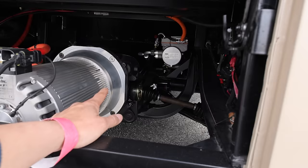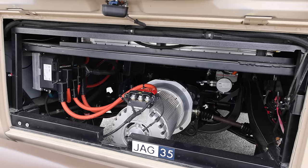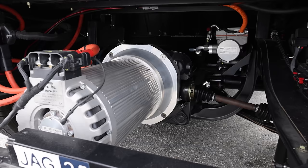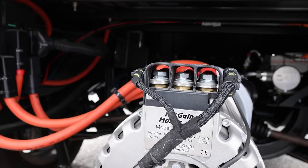All the batteries are up front. The stock Volkswagen bus transmission can handle this power because bus transmissions in this form are the strongest variant — stronger than a normal Beetle. Anytime people do sand rails or swaps, they use upgraded transmissions in the bus form. It now has a radiator — just a small one — that's all it needs.